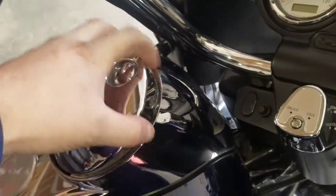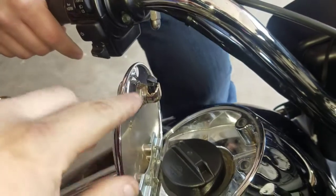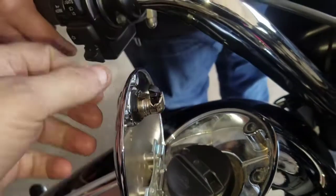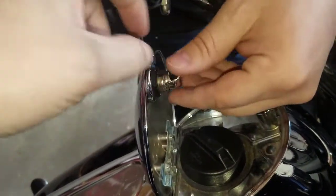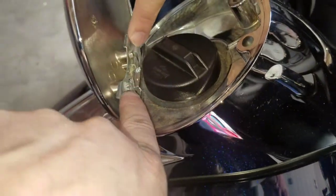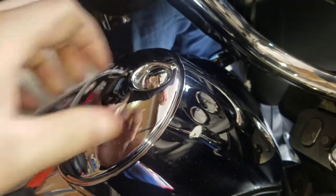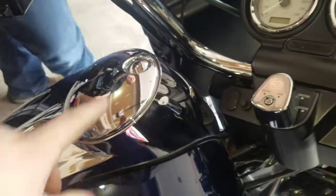These buttons are pretty cool because when you get your bike, the last thing you want to do is be digging through your pocket for your keys to get gas. They're real simple to do — you just undo this nut right here, put your new button in, and they come with this because the key will have this same deal. So you'll pull your old key lock cylinder out, slide the new button in, put your nut on, and then it'll come with this new plate here that you'll have to replace, so that way it gives it some bounce to get up out of there. Because normally with your old one, you have your key and you grab it and you pull it. Those are pretty cool. I think it was $40 now. $40? That's a lot.